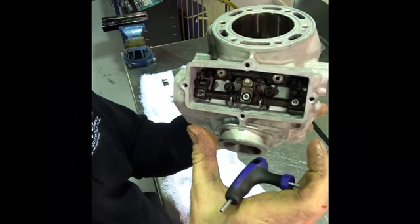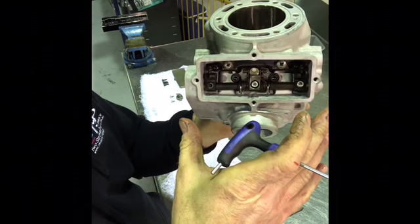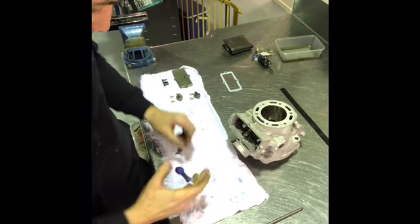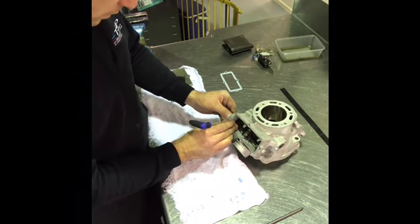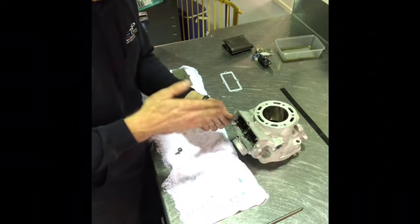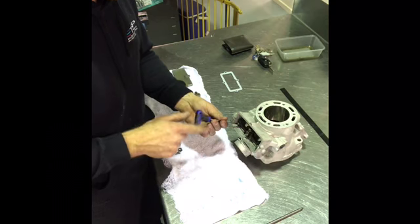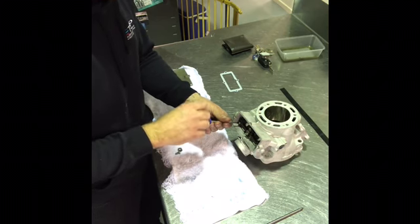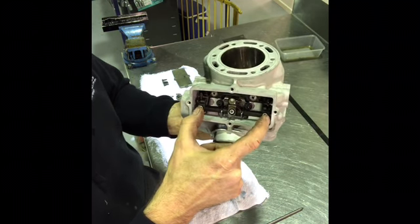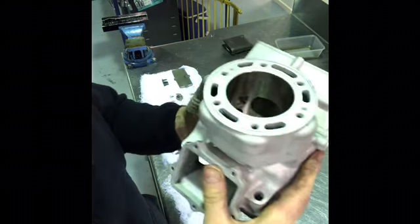The reason why you do that is to ensure that when the whole system is in the closed position, you need to make sure that the cylinders are fully closed. If you tighten up these 3mm head bolts and the ramps are not located properly side to side on the main shaft, what you'll find is that the cylinders, when you look through the bore here, won't actually be fully closed when the power valve is in the closed position. So I've left these 2 bolts here slightly loose at the moment, so I can move these ramps side to side a little bit.